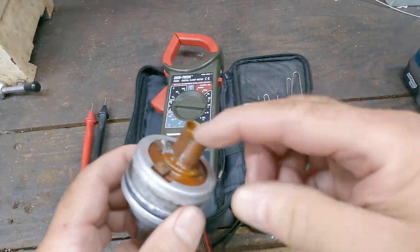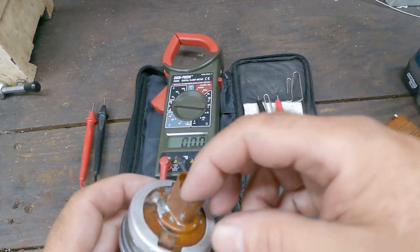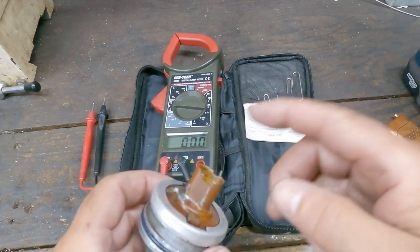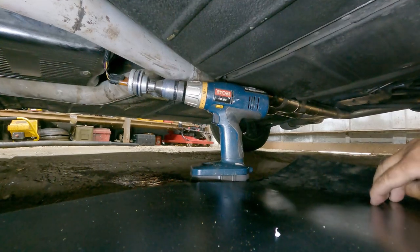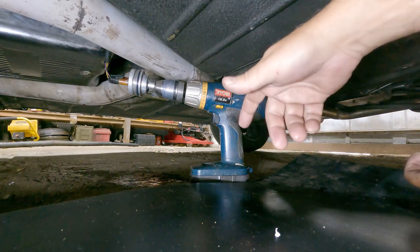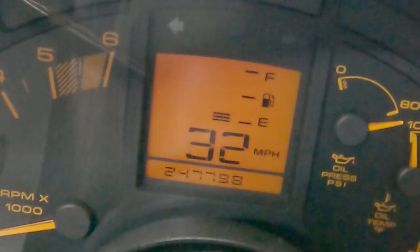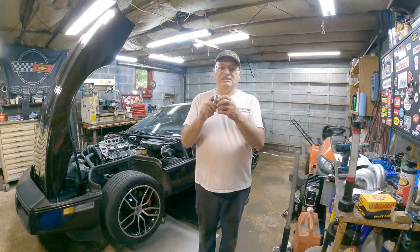This thing is so old — you can see this part here is broken, and even though the connector stays in by itself, it's not sealed from the elements like it's supposed to be, so I'm going to replace it anyway. But I'm going to show you another way to test this. Plug your VSS into your connector, hook it to the drill, and spin it. Have somebody watch the speedometer while you operate the drill with the ignition on, and you should see the MPH go up. As you can see, my speedometer worked, which means everything from this VSS up to the speedometer is good.